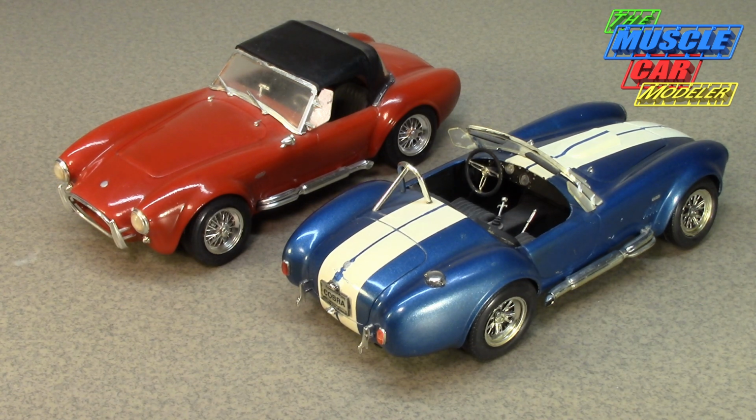And Chevy did have a 427 as well, but that was the Z11W motor in '63 and not the Porcupine Head 427 we think of today when you say Chevy 427, which really didn't come out until late '65 and was popping up in '66 cars. The 426 Hemi actually displaced 426. The Ford displaced 425 point something, almost 426 cubic inches, but that's marketing and nobody really counts that. But I'll get more into some of that another time.